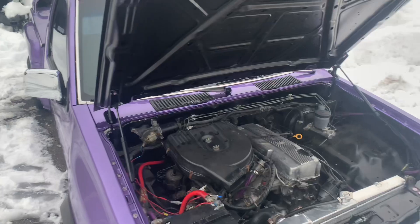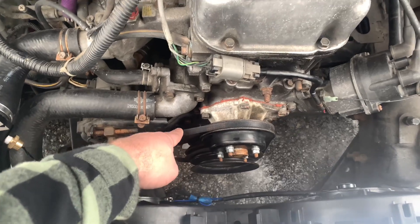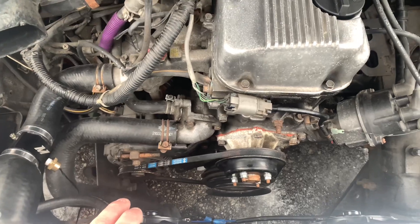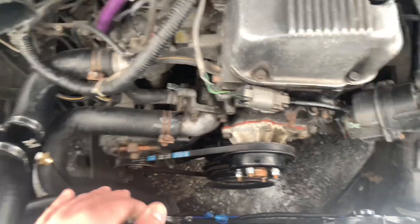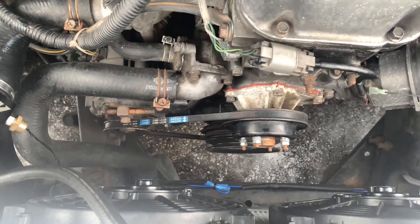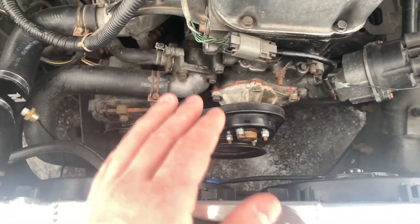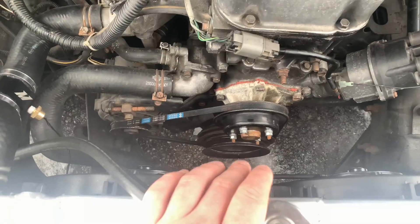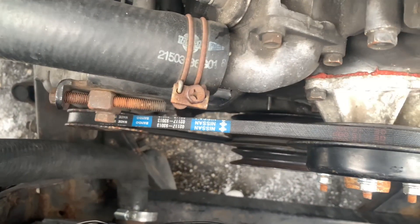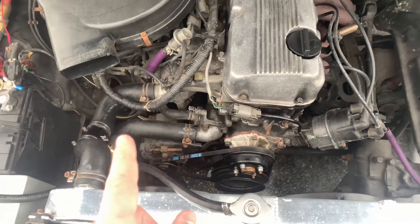And that brings me to number nine. The worst part about this truck of all time is the belts. I only have one belt right now, but usually you have three options: your alternator belt, your power steering belt, and your AC belt. What a pain. My biggest recommendation is go with a Nissan brand belt. I'm changing them every oil change — and granted, I beat the hell out of these trucks — but just the belt squealing, the second your belt starts to squeal, it's time to go do my maintenance belt change and go to the Nissan dealership. They're not very easy to come by either — usually got to wait a couple of days to get them in. So that is one pesky peeve about these trucks.